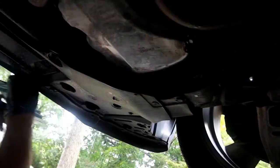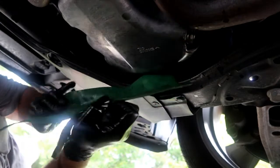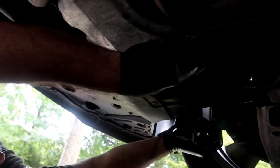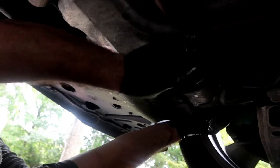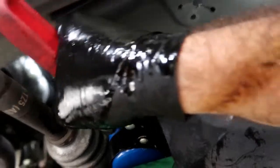I'm going to slide my bucket over here and take my Forma Funnel. I'm going to make a little bit of a lip on the back side, like that, and shove it underneath the oil filter. I'll try to catch any kind of oil and direct it into the pan if I can. Put my oil filter wrench on there and just break it loose. Get that wrench back out of the way.